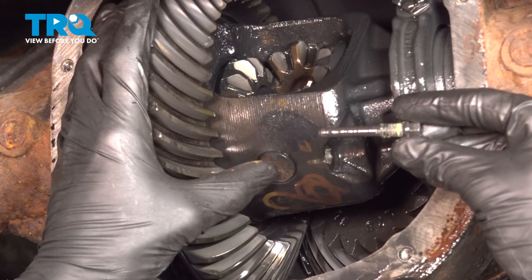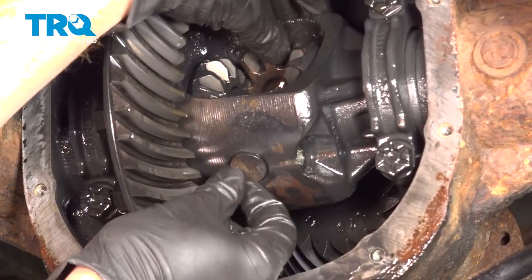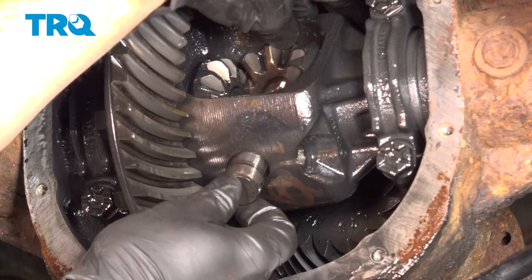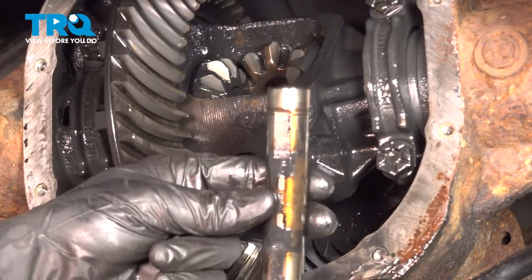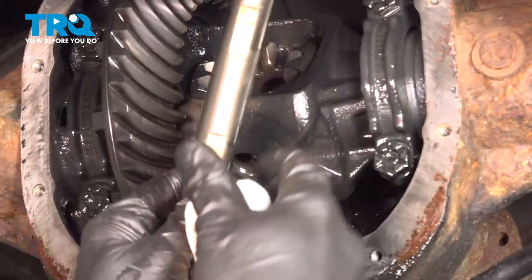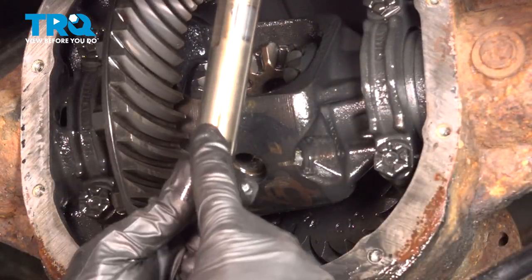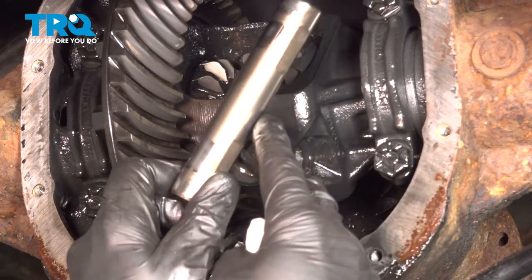There's that mounting bolt — give it a quick inspection. Now we'll carefully start removing this. I'll press along the top to slide it out of position. Go ahead and clean that up and give it a quick inspection as well. When we're inspecting it, we're trying to see if it looks like it's cracked or damaged in any way. This one doesn't look bad at all.